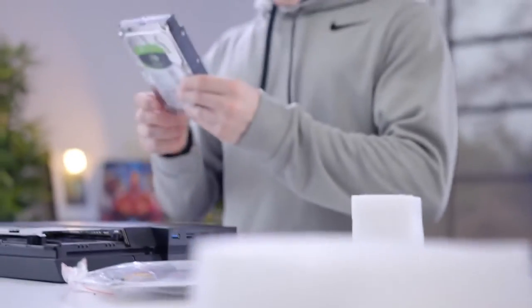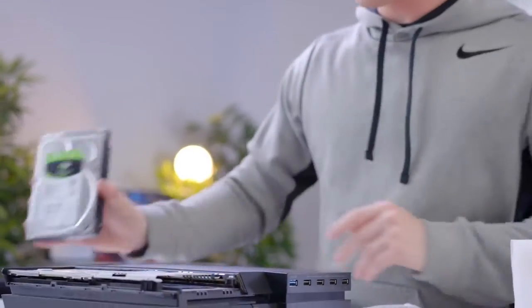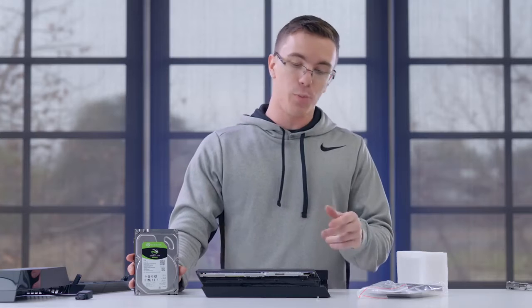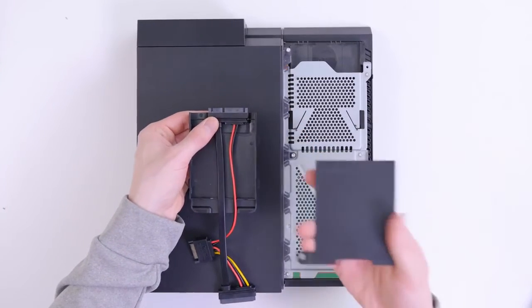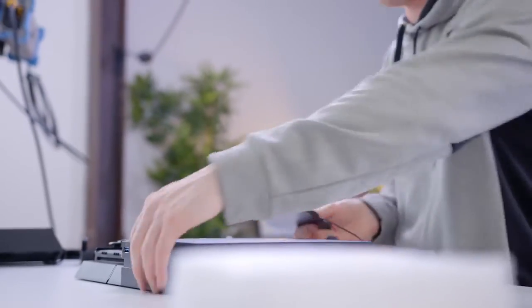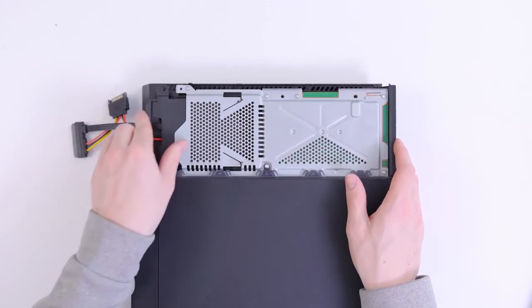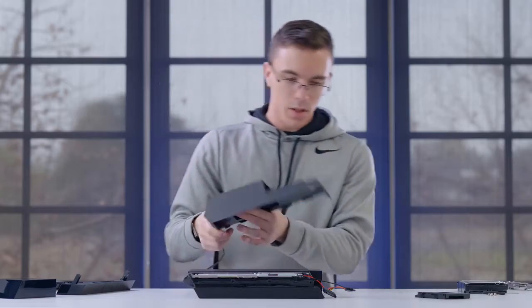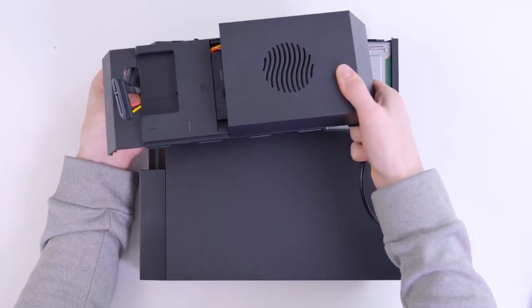To really go all out, we're upgrading this with a four terabyte hard drive. This actually supports up to six terabytes if you really need all the storage you can get. On top of that, they actually just announced a new PS4 firmware update that will allow you to put games on external USB drives. So if you really want to get crazy with it, you could put a ton of storage in your PS4. I just need to set the SATA cable in like that and close the whole thing up. This is really just a pass-through — we slide it into the standard PS4 slot and screw it in. Here goes nothing. We want to run all our power and data through this little slot.